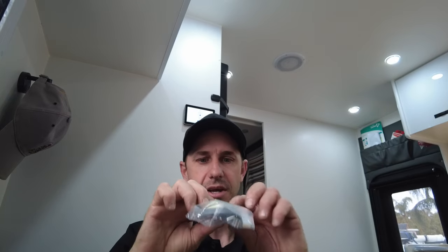And zero it off because that means your sensor might even say 3 centimeters. So it's still measuring 3 centimeters of water, but it's enough to be below your water pickup. It's a good time to zero it off. And even if you want to make it maybe half a centimeter above that so you get a bit of a pre-warning, that's up to you guys. I do that. That way I get a little bit of a pre-warning before the tank's actually going to be empty. So good little tech tip for you guys.